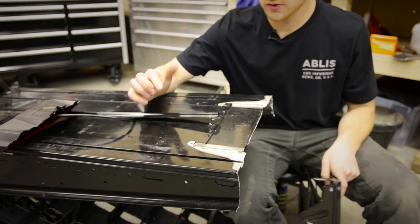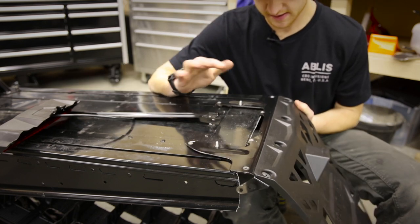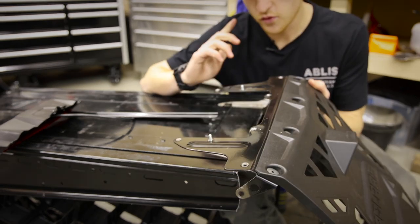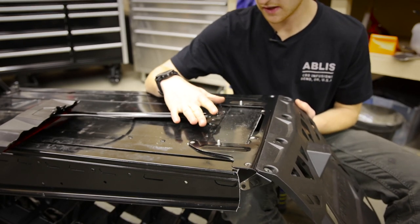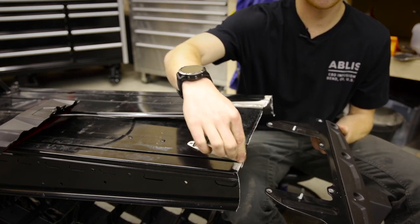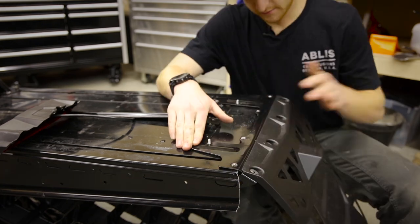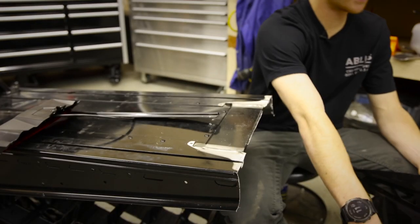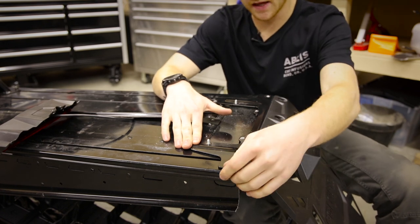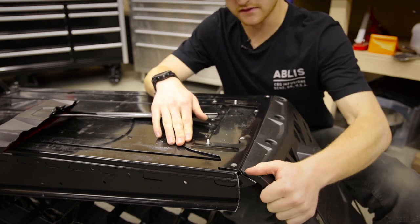Once you've made your first cut — whether with fumbling or precision — here's where it gets important: these four rivet holes right here, one, two, three, four — you cannot use those anymore. If you try to use those you will 100% drill into your cooler. The only holes you have left are these two that you'll be able to relocate. We're actually going to drill a hole in here and use this T-slot — the one they use to mount the bags — to help secure things for added support. About an inch is already gone, so let's see how we can slide this back and sand the high spots to even it out.